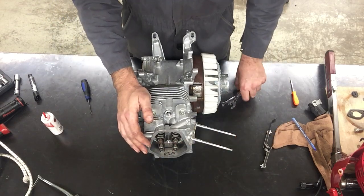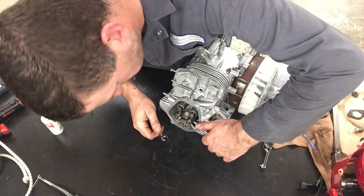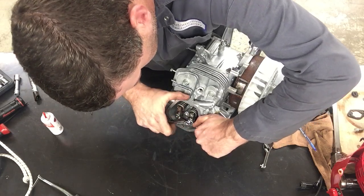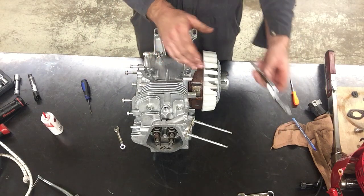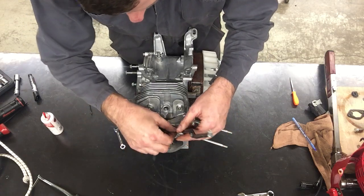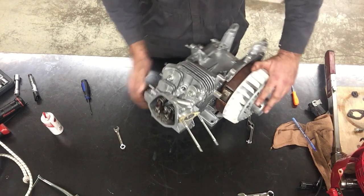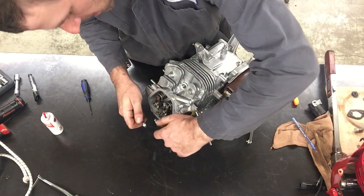When I tightened it before, the students noticed I moved a little bit. So I'm going to open it up a little to compensate when I tighten it down again. This time I didn't measure it but I know I'm very close because I opened it up some. I'm going to try to slide that feeler gauge in — still a little tight, so I'm going to back it off again and play this game until I get my desired clearance. I opened it up again and tightened it down.